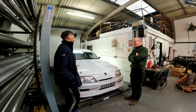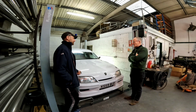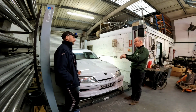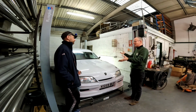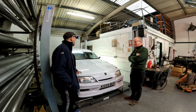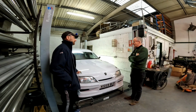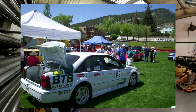You'd think so, but the first thing we discovered when we took it out the other side is that everything on the car was loose. All the nuts and bolts, particularly anything with aluminium fittings, like all these Aeroquip fittings, the mirrors were hanging off. Because the ambient temperature is so high, you've done everything up nice and tight in the UK, and you get to America and suddenly all this stuff is loose. So we had to go through the whole car and make sure every fitting was tightened up. That was one of the key things that we realised, so lots of time spent in car parks doing pre-race preparation, making sure that it wasn't going to come apart on us.